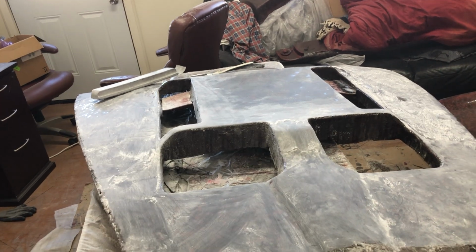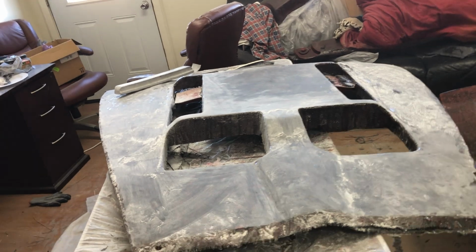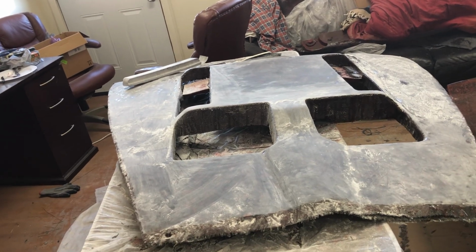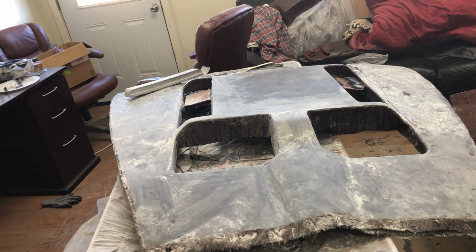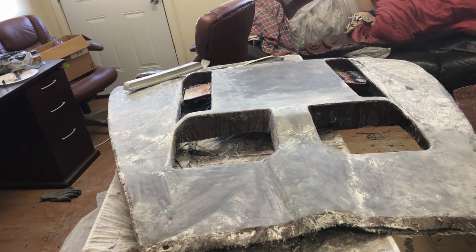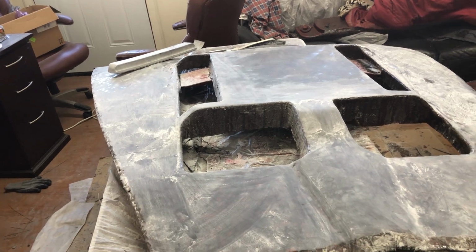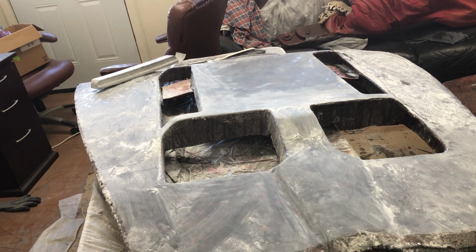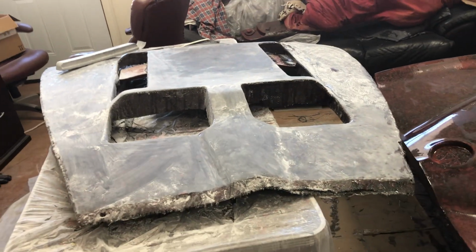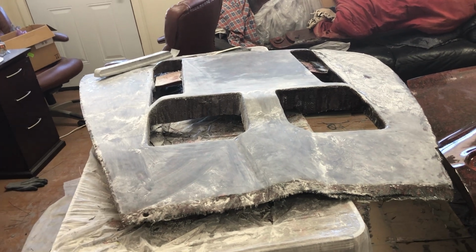The specific epoxy can go up to 72 hours without requiring resanding. So rather than wait or sand, we just go ahead and put a couple of layers on to get it built up. Then we have to sand. And usually there are several stages of sanding and fixing and sanding and fixing. So the disadvantage of using this approach is exactly that. It takes a lot of sanding.